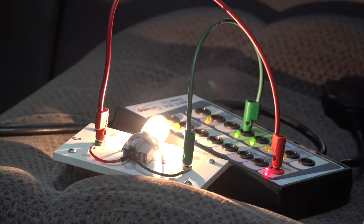If I could not find anything that was being powered, at least obviously, by that data link connector or by the cigar lighter or the auxiliary output, then I would have to do some digging in the wiring harness. Chances are real high then that someone spliced something that is obviously drawing power in that circuit. So again, if I saw nothing obvious here, then I'm going to unfortunately tear some of the dash apart to trace that wiring.